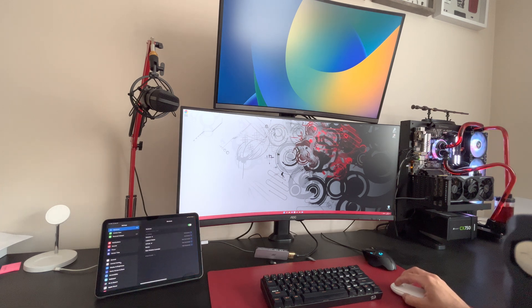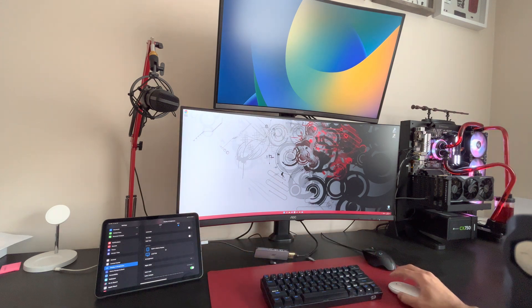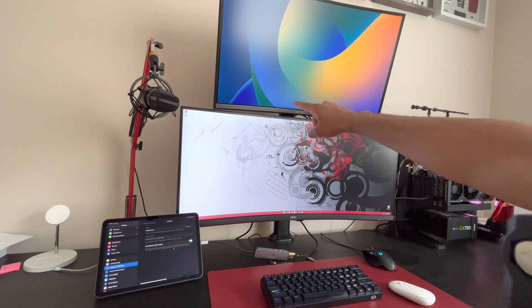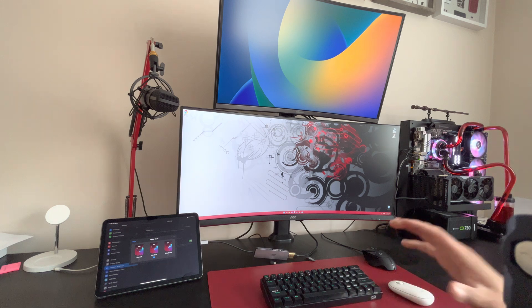I want to do this with you guys so you can see what I'm doing and run through all the troubleshooting with me. You can see there are some display settings here that you can change — it says built-in Retina Display and the monitor model number that I have hooked up. I can go ahead and change that setting so it affects that monitor. Let me try standard or zoomed and see if that changes anything — I'm trying to get the dock to appear at the bottom.